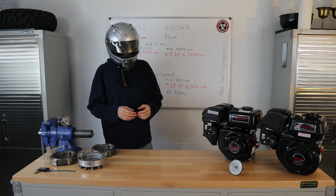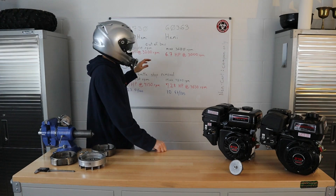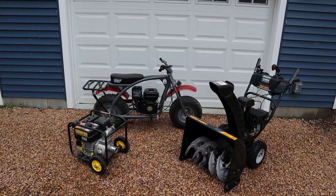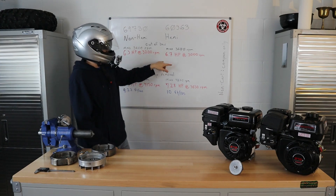The Hemi, by name — the Hemi head has a very flat top, and the non-Hemi has an indentation in it. What does this translate into in real-world use, though? You have some dyno numbers from the same dyno, the same day, the same operator, the same location, and you have a comparison between the two.